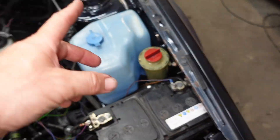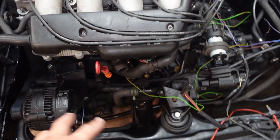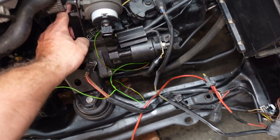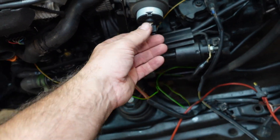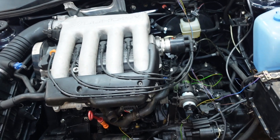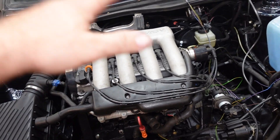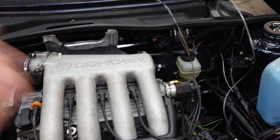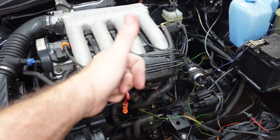I've got the bonnet cable to fit, coolant lines at the back for the heater, expansion bottle to fit, the rad to fit, do the pipes for the radiator, get some fluid in it. I've left the thermostat plug off and put some coolant in it so it doesn't overheat running dry. Also need to finish off the exhaust and do the back box which is the hardest bit. Then at that point adjust the map and get it running a lot smoother. That's going to have to be next week - so peace out guys, keep watching, keep subscribing, keep liking. The ABF is running - peace out!